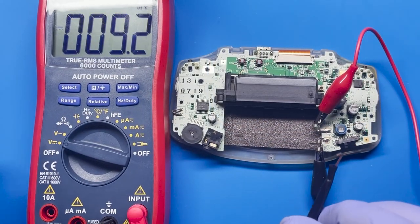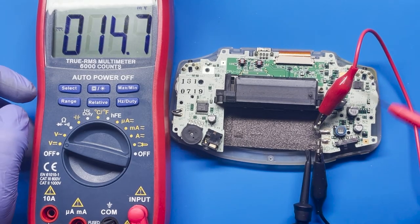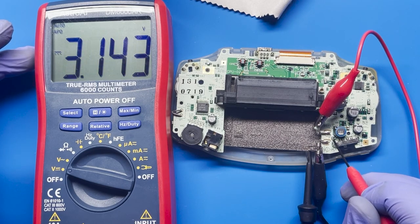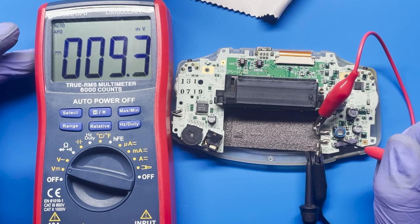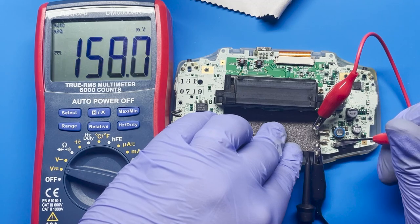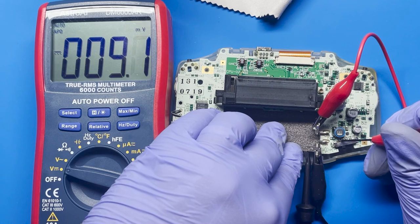This is connected to my multimeter so it can free up my hand and I can probe around the motherboard. We connect this to the negative terminal, and with the red probe we should be getting three volts or around there — and we're getting 3.14 volts. This is the F1 fuse. We're getting 3.14 volts on one side. This other one is giving 9.3 millivolts. That doesn't look right — pin two should have around the same voltage, and it is showing 9.0 to 8.7 millivolts. So that's way below the 3 volts that we need.